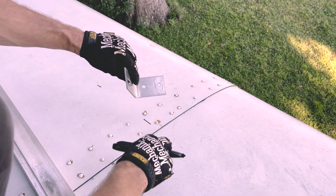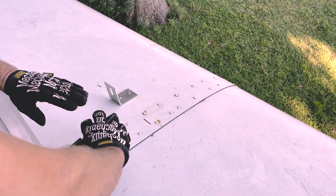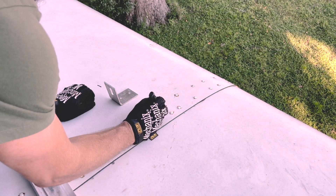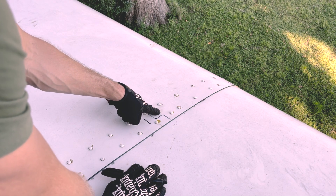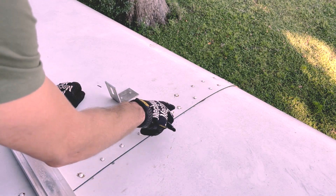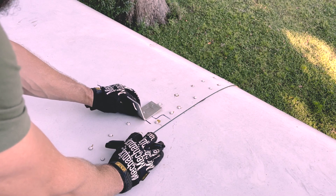These brackets come pre-drilled and we always mount this system right over the rivets — the rivets are the strongest part of the bus. You've got this piece of sheet metal overlapping another piece, with hat channel on the inside. If you put the brackets between the rivets it's easier, but you only get into both pieces of sheet metal. If you go right along with the rivets, you're also getting into the main frame on the inside. In this case there's a rivet right in the way — I'll show you how to resolve that.